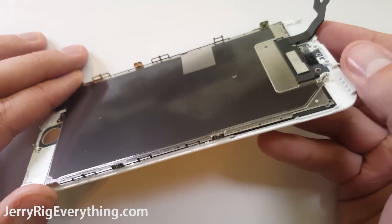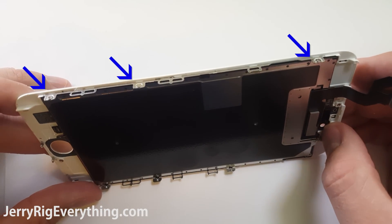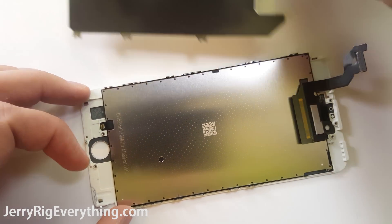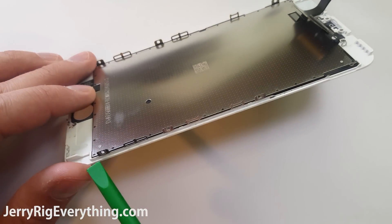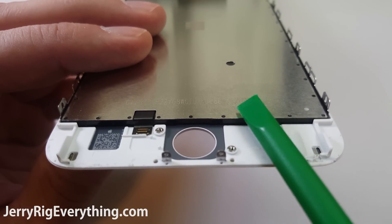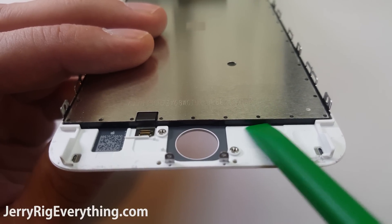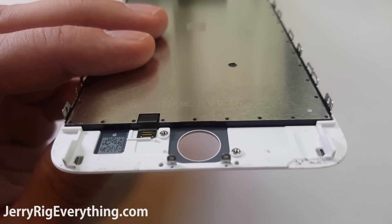There are 3 screws along the side, one at the top, and then 3 screws along the other side. Those are for the back metal plate that rests against the pressure sensor for the screen. Here is the 3D touch component. If at all possible, you want to buy a replacement screen with the 3D touch already attached — the 3D touch sits on top of the LCD, which is attached to the glass screen of the phone. This is the whole screen unit you'll be purchasing.